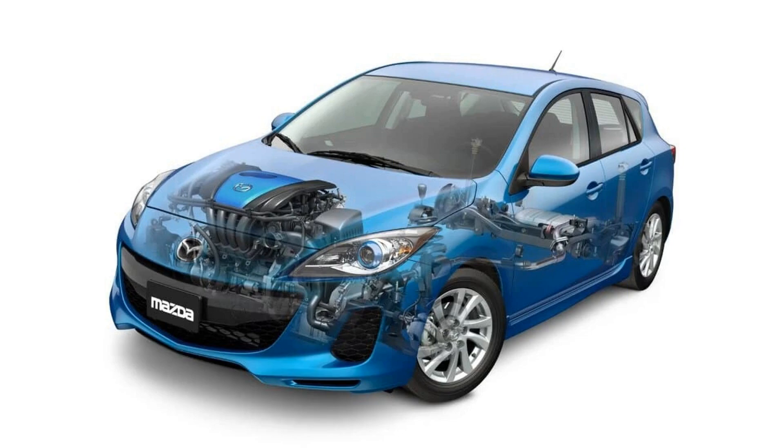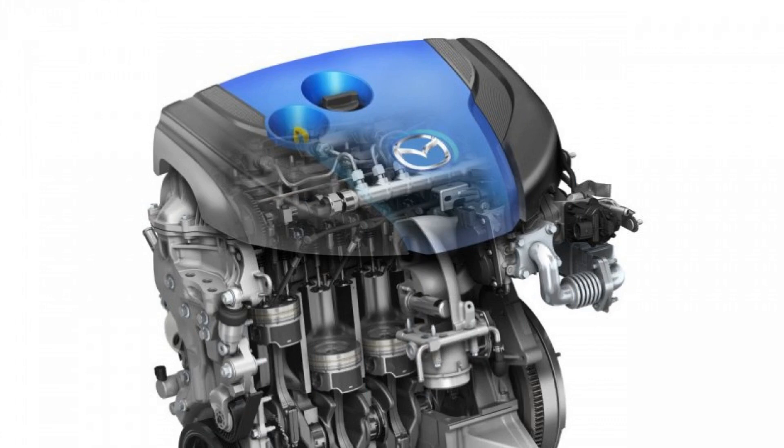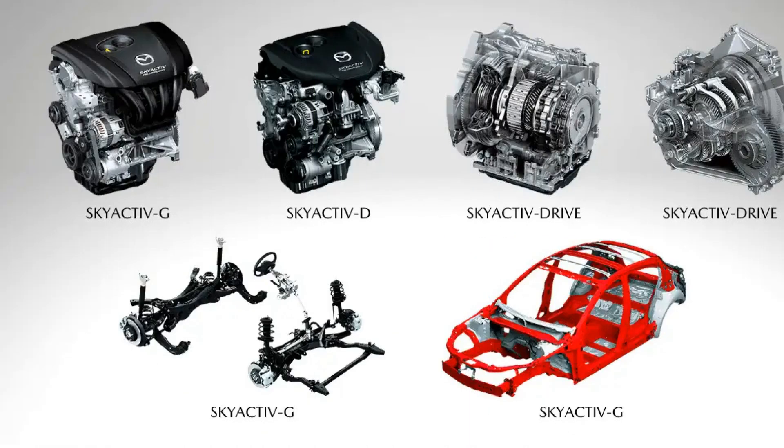A dual-mode oil pump reduces hydraulic losses. To reduce weight, the engine block consists of two parts and is made of aluminum. By reducing the weight of pistons, connecting rods, and crankshaft, and reducing the size of sliding bearings and crankshaft journals, the designers managed to significantly reduce mechanical losses. Most likely, this factor is connected to the reduced service life and early problems with Skyactiv motors. But it would be incorrect to blame Mazda engineers, as such solutions are a worldwide trend in the fight for cleaner exhaust, increased power, and reduced fuel consumption.